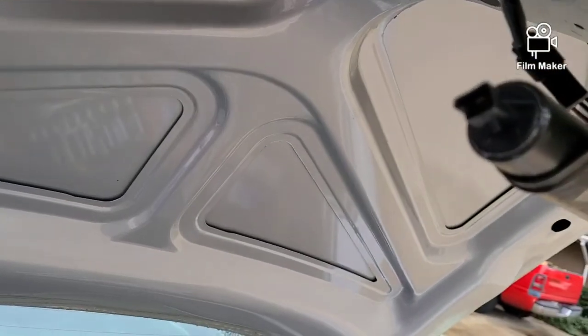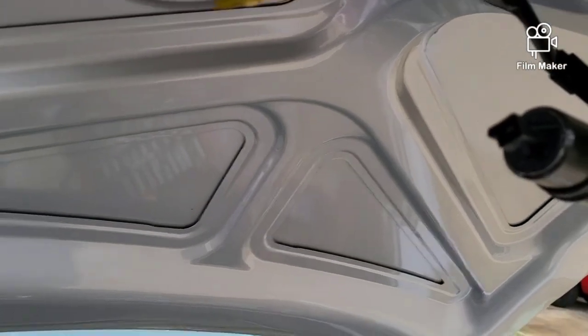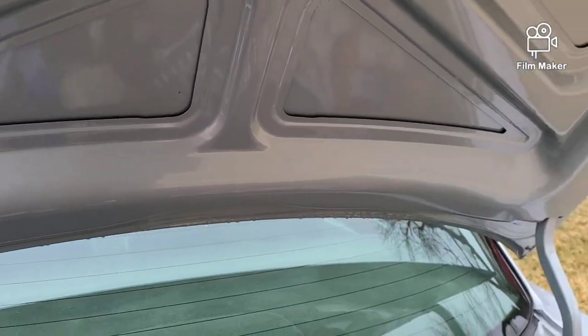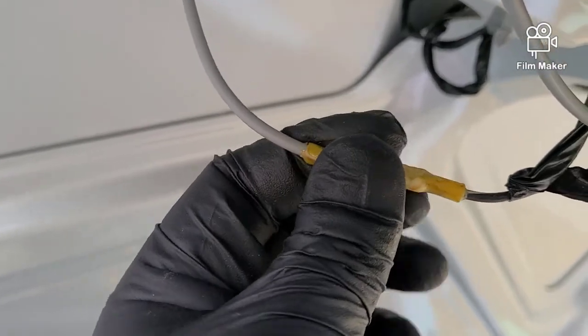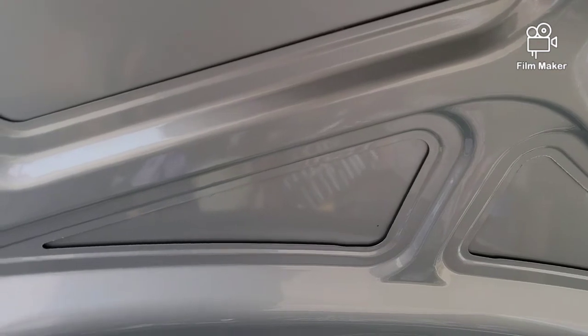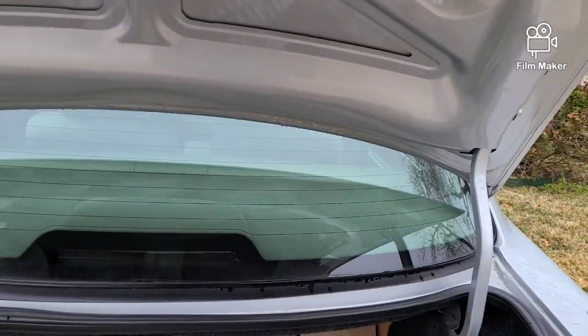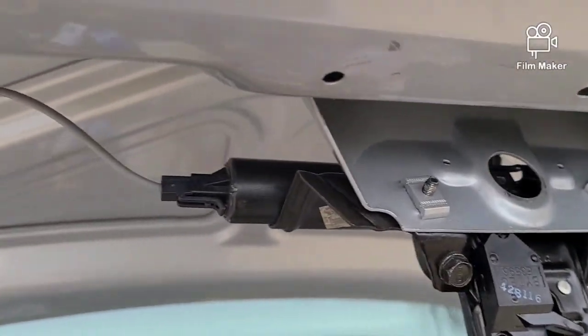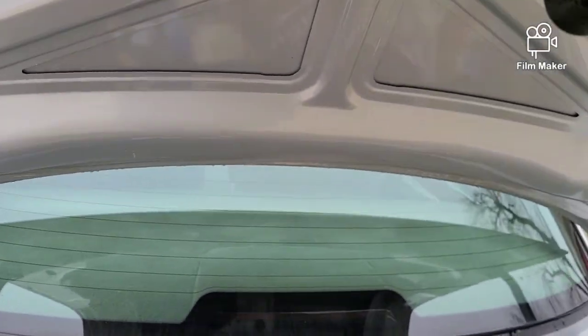I'd rather leave a little more wire than not enough — if you cut it too short you're in trouble. I ended up plugging this in using a crimper: crimp the original wire a little bit, then crimp the new connector on and run a waterproof butt connector. If you have a small torch you can heat-shrink it, but you shouldn't have water getting in there anyway. The cable just pushes on, and once it's connected, when you put your key in, it'll work.